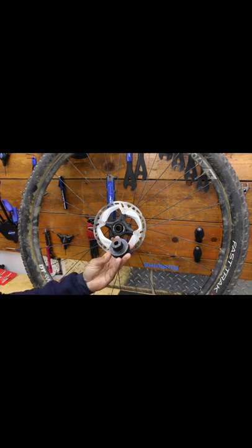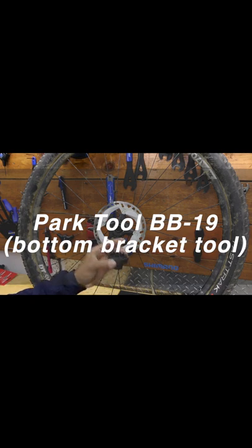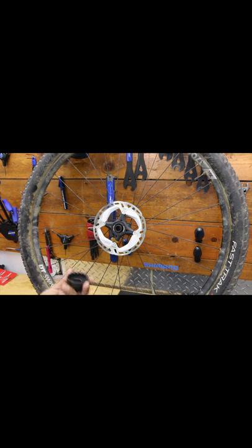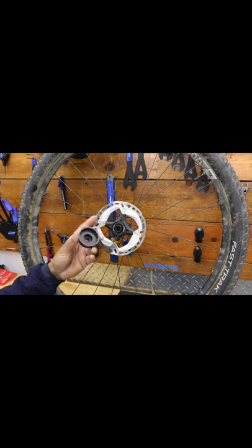So in a pinch, this is an older tool — it's a Park Tool BB-19. It probably has 19 notches in it. This will actually fit with a little bit of play, but I think I've used this before and it's good enough to keep a good bite and take this off. You want to be careful if your tools are getting worn. You don't want a loose fit, and especially if something's really tight, you want a tighter fitting tool — but in a pinch this one will work.